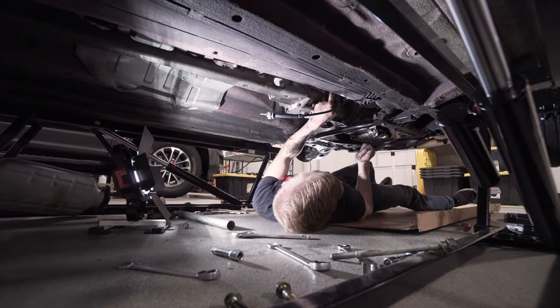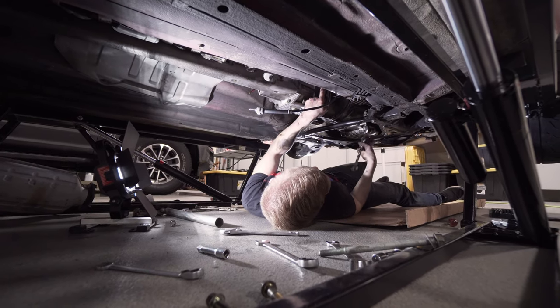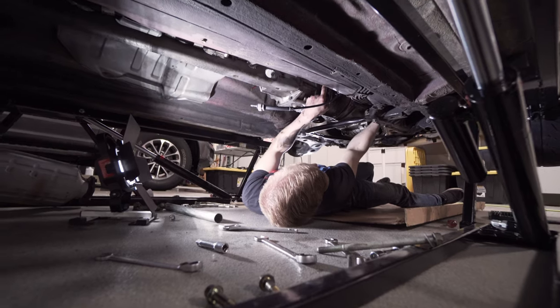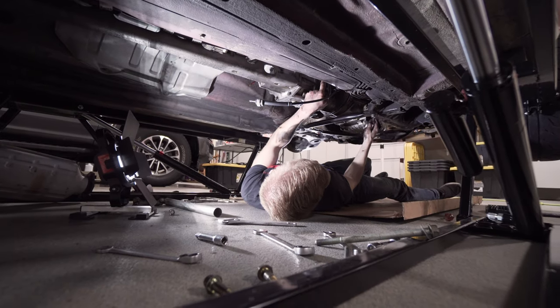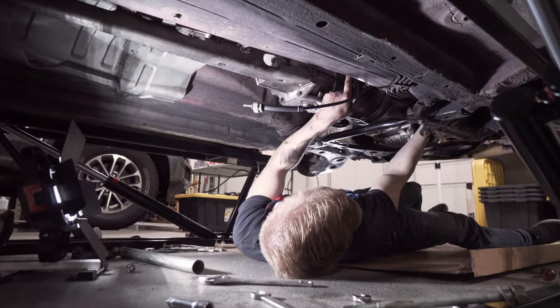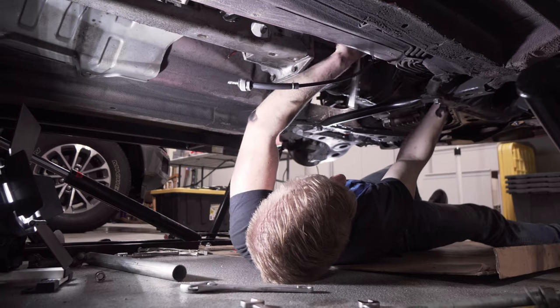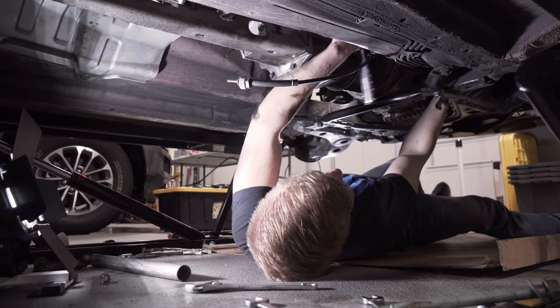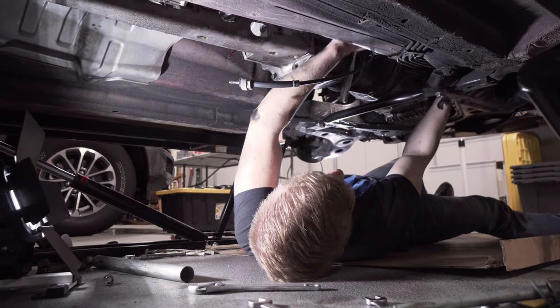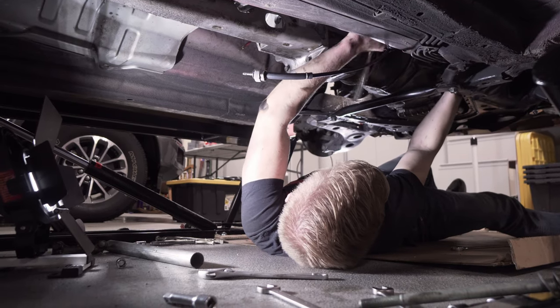I've got an 18 just above the throwout, like the slave. An 18 that has a nut on the other end, or a bolt, I guess. So I snuck this box end on there and just let it lean up against the subframe. And I've got no more universal, but I've just got my 12-inch extension. I used my handy-dandy pipe to break it loose, and now we're just getting her off. Now we've just got the lower four, or lower three, I guess.